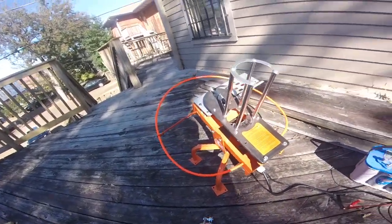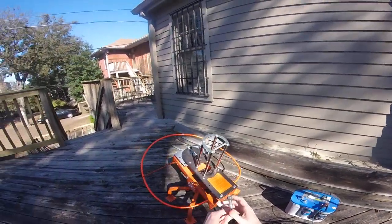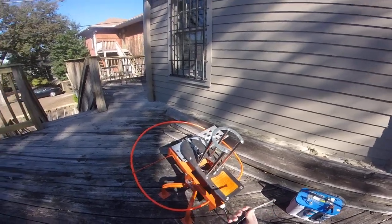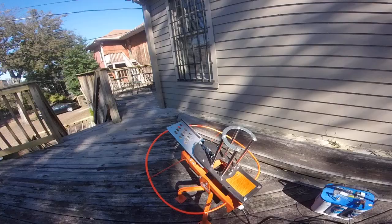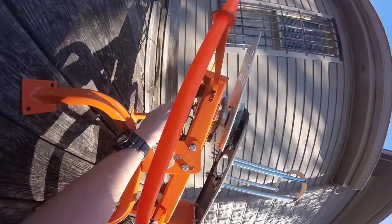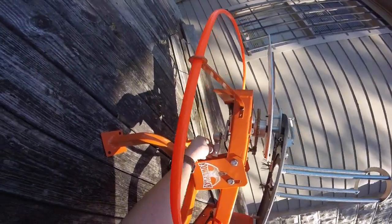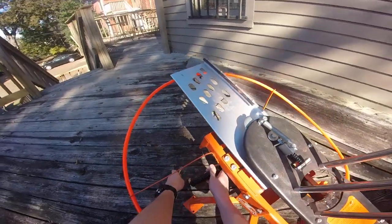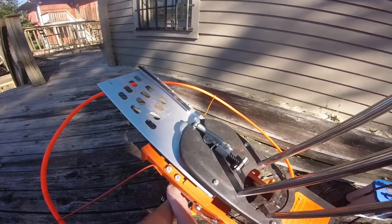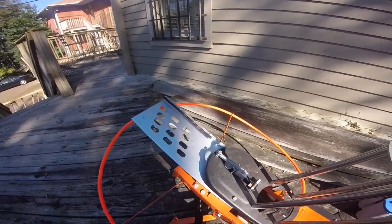For normal operation, your spade and spring bolt — to attach this, you're going to need to move your arm into the 12 o'clock position, at which point the spring hook under here will be at its closest point to the back. You can then attach the spring and thread it through the back of the machine.